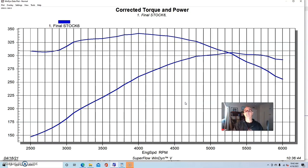Then we went to the wrecking yard and got a set of GT40 or GT40P heads. The flow rates and performance of those heads are very comparable. One thing to mention: the GT40 and GT40P heads came in different-year Explorers, so check which one you want. I recommend the standard GT40 iron head over the P head, because the headers for the GT40P are specialized — they will bolt on, but you run into interference with the plugs and plug wires and end up burning them.